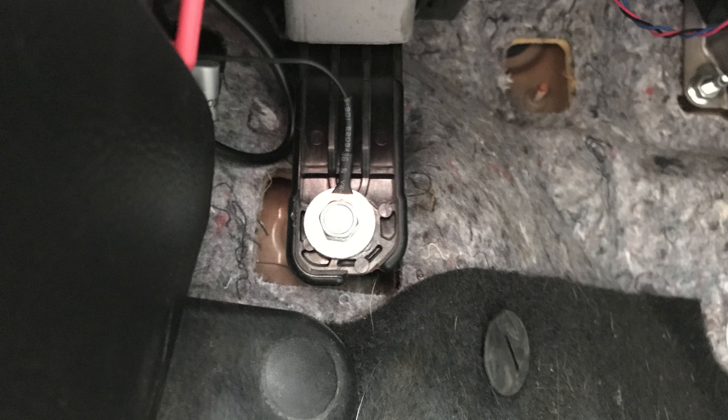Now that you have all your wires pulled through, it's time to find a ground. Take your meter and set it to ohms. Go after one of the bolts on a door hinge — something you know is actually going into metal on your car. Then probe underneath your dash looking for another bolt that is grounded to the vehicle's metal as well, and that's where you'll make your connection.